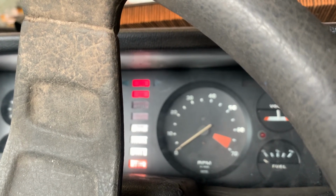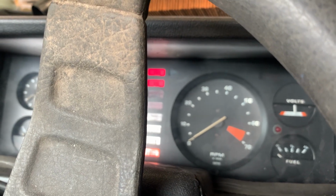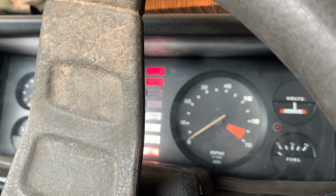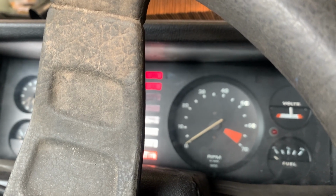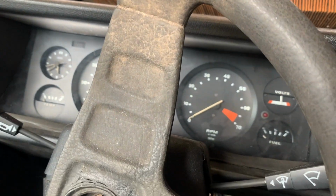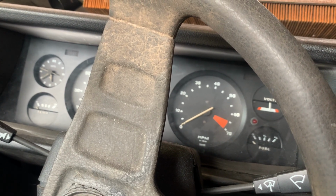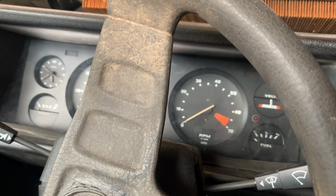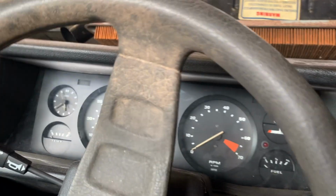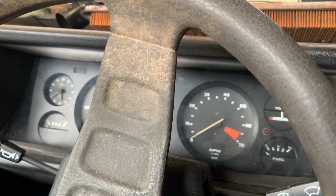The electrical circuit, and I had my temp connected up to the oil, so that's why that was happening. So I moved the temp over to the correct node terminal, and then I had to give the wiring a bit of a pull through the back of the firewall over there in order to get it to reach the oil, which I then did. Great.